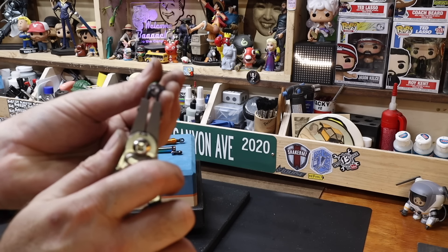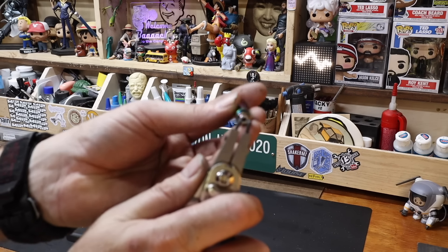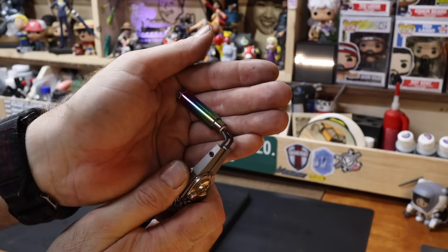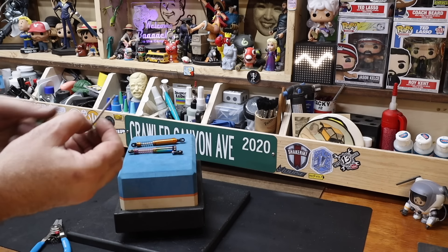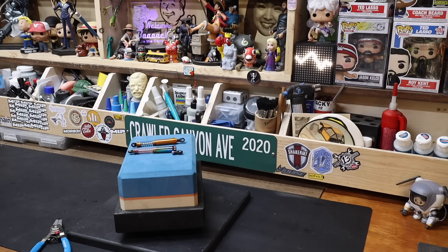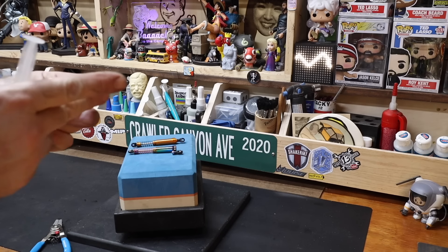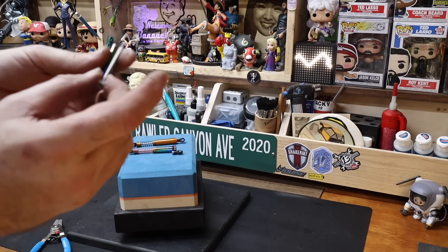We're going to loosen this one because you can do this more like a traditional shock — like an associated element shock — because I can loosen that way out. When we insert through there, we have less of a chance of snagging a seal. It's the skinny spacer, two seals, two X-seals from the 2362 — the usual stuff to put them together.